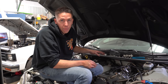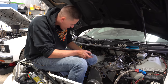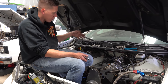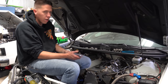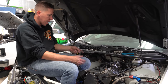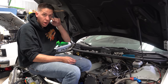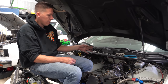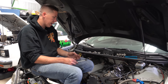Sometimes you just got to climb in here to get a little bit closer to the bolts - F-body life. If anybody's worked on one of these they know. Just trying to get the grounds off the back of the head, and then pretty much other than valve covers we'll be able to go inside and under the car, unhook the trans, and then the engine comes out. A lot of people will tell you to drop the cradle in a Camaro and drop everything out the bottom, but after doing the raised stand-up radiator it's pretty easy to get the motor out - the trans doesn't have to come out.